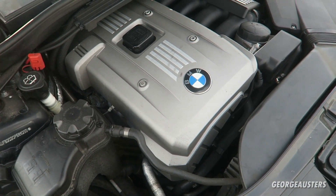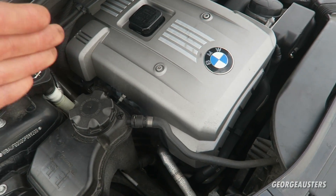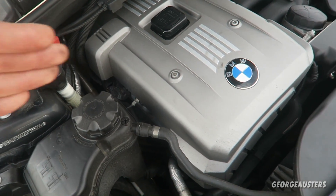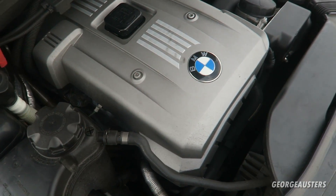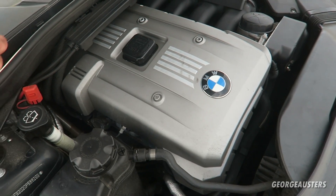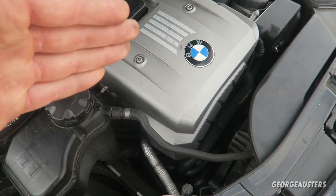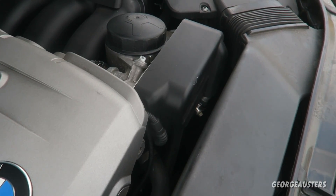Another part to fail is no secret — it's the spark plugs. They should be replaced every 30,000 miles; do not wait until you get a misfire. If you do get a misfire, replace all of them — don't just replace one, because the next plug will fail shortly after. Spark plugs are very cheap and easy to swap out, so get some NGK or Bosch plugs at the correct specification. After 100,000 miles I would also recommend swapping out the coil packs — if there's no history of replacement they are likely the originals. Again, get a good quality coil pack, not cheap aftermarket ones.